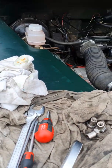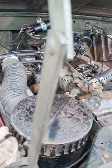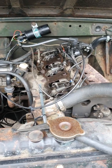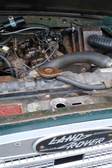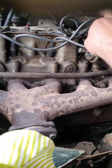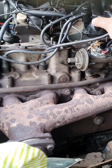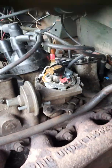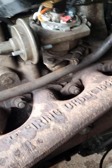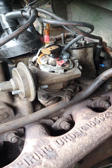The carburetor is a CD175. Lucas ignition system — I changed it to a dry resin ignition coil rather than muck about with those old oil ones. I have not used the electronic ignition in my distributor because it just didn't work out very well for me. I couldn't get the AccuSpark system to work — I followed the instructions and it just refused. I suspected I may have changed polarity but I didn't. So I took it off and put conventional points back in, just noting that this capacitor is not rubbing against the rotor because it has a tendency to do that.